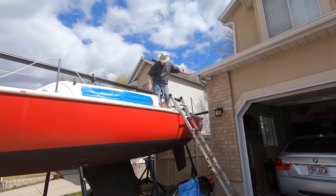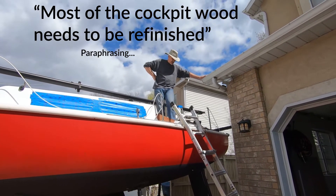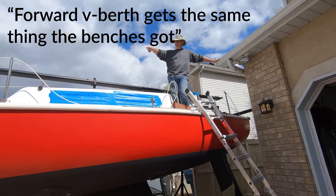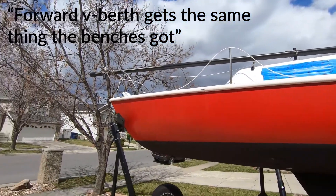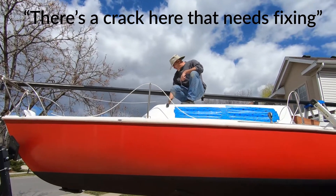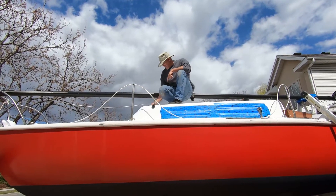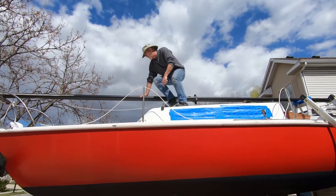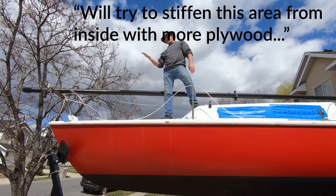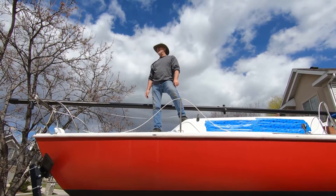So run me through what's left to do on this thing. Well, this wood here did not hold that very good at all. So I'm gonna probably take this wood off again and buy actual marine varnish, varnish those, then put a layer of plywood down in the bed just like I did on the side bench. And up here, right next to the mast step, there is a crack that I fixed before but it didn't stay fixed — I think I used foam on it instead of fiberglass. So I'm gonna fix that and reseal all these because somewhere I'm getting water in. And then this chunk here is really springy so it's tough to walk on, so I'm gonna try to get inside and glue the plywood to the bottom and tighten that up. Then this thing's ready to go.